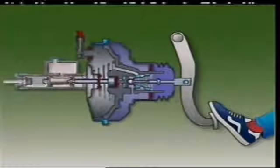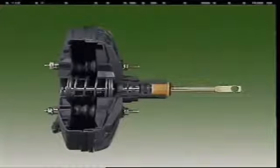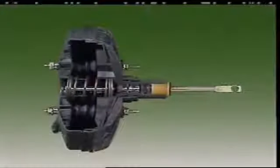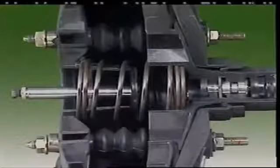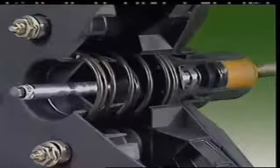When the driver moves the brake pedal pushrod, it transmits movement through the power unit to the master cylinder piston to apply the brakes. It also operates a control valve that admits air at atmospheric pressure to the rear of the unit; how it works depends on the position of the pushrod. A hose connects the intake manifold to a vacuum check valve on the power unit. With the engine running, the vacuum in the intake manifold is used to evacuate the power unit. This valve is held off its seat and a vacuum is produced in both chambers of the unit. The chambers are separated by a flexible rubber diaphragm attached to the diaphragm plate, held in the off position by a diaphragm return spring. The master cylinder pushrod and the control valve assembly are centrally located on each side of the plate.